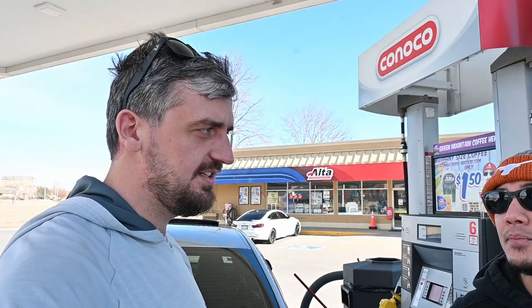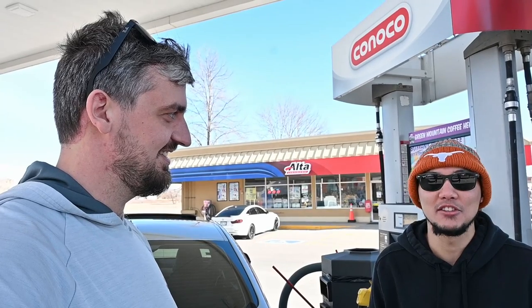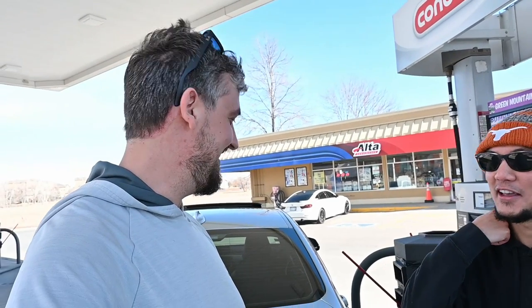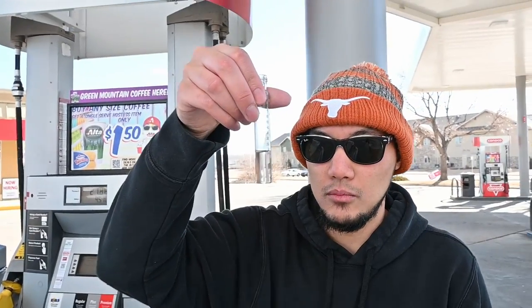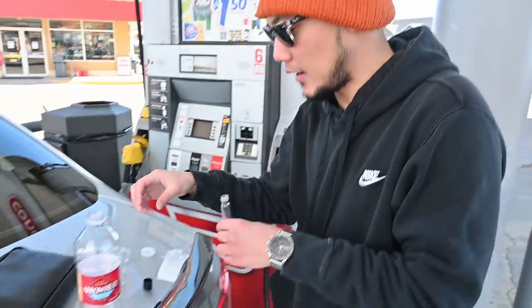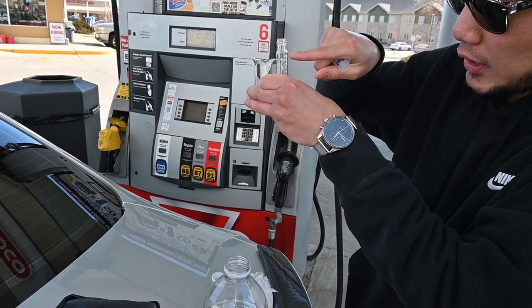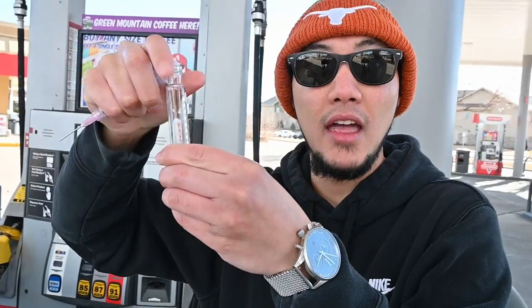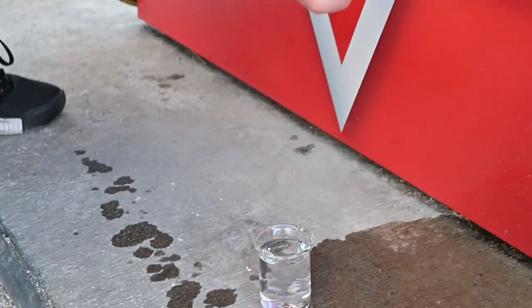How much power did you have for your tune before you went e30? I was on Stage 2 91 with a remote tune, and then someone said 'do you run ethanol? It's great,' and I haven't looked back — it's been like almost a year. Every time you fill up you test it? I do test it every single time I fill up. So I just filled up, there's a water line here — I filled up pretty close to that water line. The next thing I'm going to do is pump about four cents worth of ethanol into this beaker, then take the syringe and fill it up to the fuel line at the top. We'll mix it, shake it, and then the ethanol and water will separate and tell us where the ethanol percentage is.